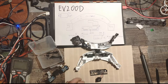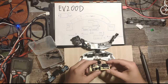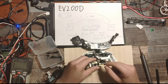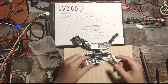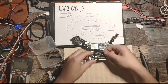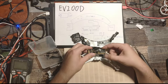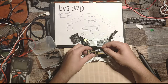Next step: we reconnect the main ribbon cable — this one here — and put it inside the latch connector. I hope you can see this, but if not, you know what I mean. Just put it gently in there, then clamp it down. The ribbon cable is in again. Just push a little bit here because there's double-sided tape underneath so it sits nice and tight.